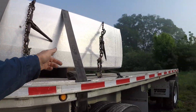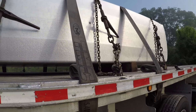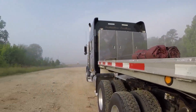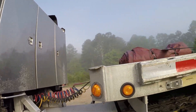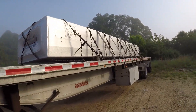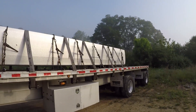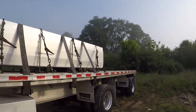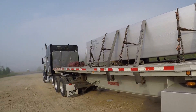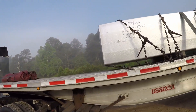I'll start at the front throwing all the straps over, walk around this side, and with my bar run it through, fold it up, tighten it — all the way back to the front. When I'm done I'm already back at the front of the trailer and I just walk up and put my bar in the headache rack. A good idea is always to walk around one more time — a complete circuit — double checking you haven't left any gear on the trailer, checking your tires and lights. Whenever I forget that walk-around, I invariably leave something on the deck and have to stop and get it.